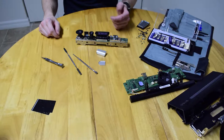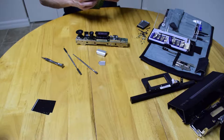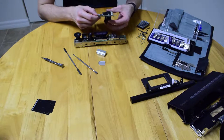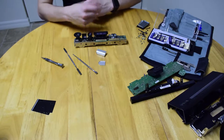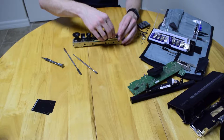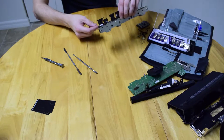If the fan craps out, replace it like for like. If the fuse craps out, see if you can find one — it should be labeled on it. You'd have to look up what an SET-X9 is — it's probably going to be like a 2-amp fuse. Or do what I did with Peanut Gallery's Kinect and just twist the wires together and put a little dab of solder on it — and pray it doesn't blow again. The problem with bypassing a fuse is that if it goes bad again, you have no protection for the circuit, meaning something further in and less fixable could fail.